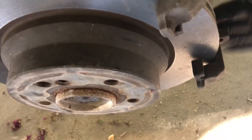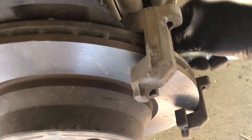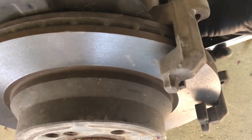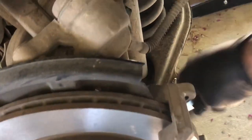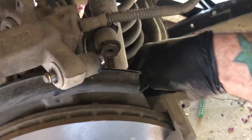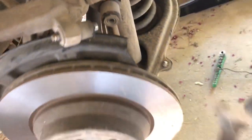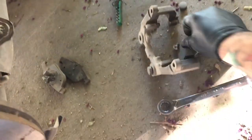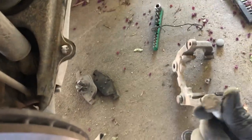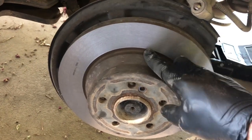You can clearly see why we need to cut the rotors. The bolts in the back that hold the caliper bracket are 18 millimeter — use your ratchet wrench to break those loose. Once the brake caliper bracket has been removed, zip that to the side and don't lose the bolts. That 18 millimeter removal is going to allow you access to the rotor.